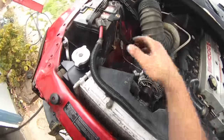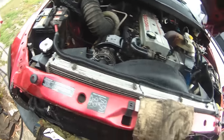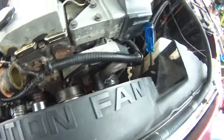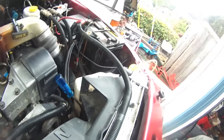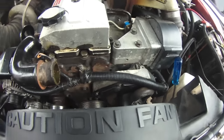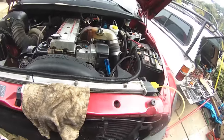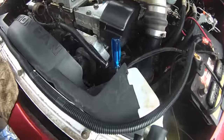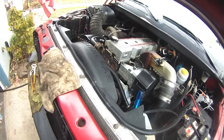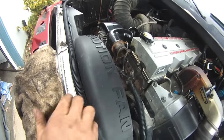I removed the recovery overflow and drained down — I stuck a siphon in there and drained down about half the radiator so I could remove the upper radiator hose. It just gives me more access. I'm also draining out the washer fluid now. I could have probably figured out a way to get this all out of the way with the upper radiator hose up there, but quite honestly it's so easy to do — just two hose clamps and about three quarts of fluid drained out, almost a full gallon of antifreeze. Not horrible.